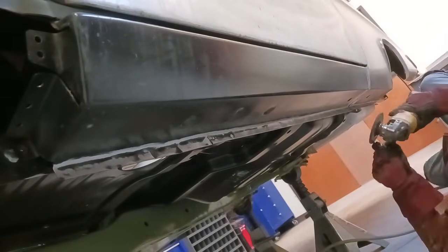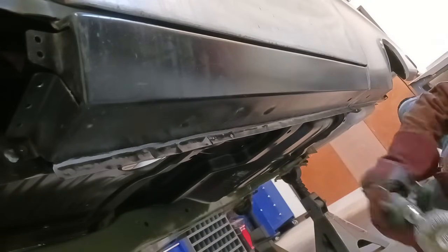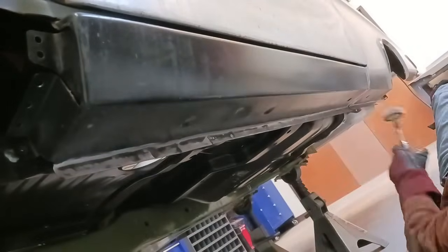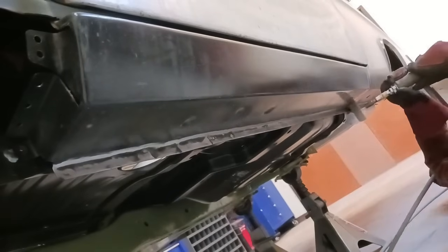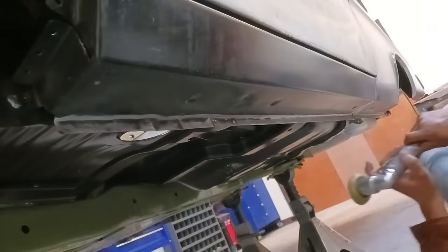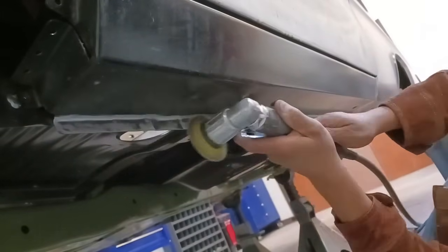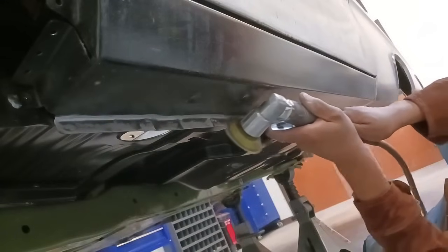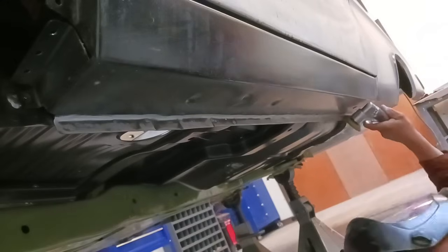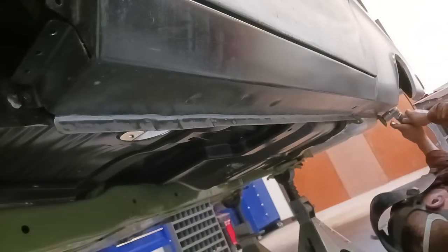And I didn't say it before, but personal protective equipment, PPE. If you get hurt, well, your project doesn't matter now. So always protect yourself. And we've got that flap disc again, or flap wheel. Now this is a little 3-inch orbital, and it's a dual action sander. I have probably 180 on that, and that makes it blend in really nicely after all of the grinding and the flap wheel is finished.